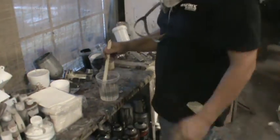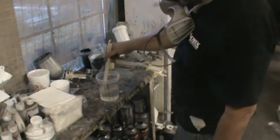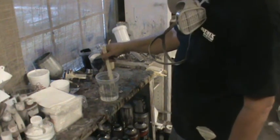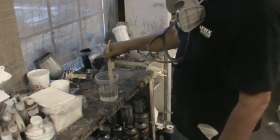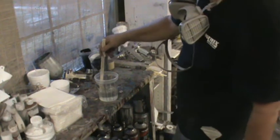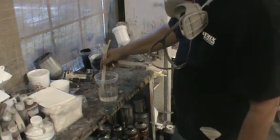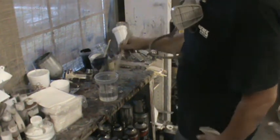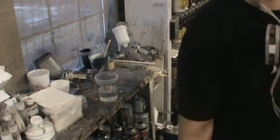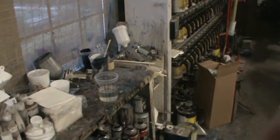I do know that HBR watches my videos, and I did want to mention one thing. I saw him using the LEMCO reducer. And just keep in mind, the LEMCO reducer is a polyester-based paint line, and your PPG stuff that you use is urethane. So those are two items that I know aren't compatible. You can have some issues if you mix those two items. So be sure if you put that reducer in your paint, be careful. You could have serious issues.